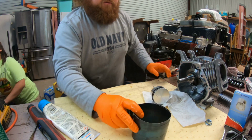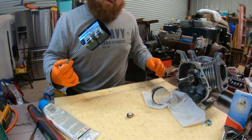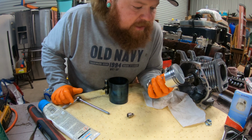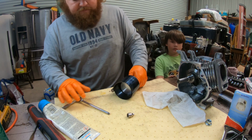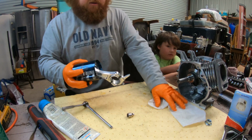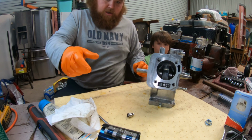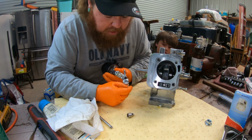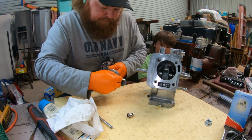Hopefully this compresses down enough. Alright. We'll start squishing this one in. Make sure one last time that you have all your rings where you want them. Slide that over. Tighten that sucker down. Now, take our case, take our bolts out. Since we oiled that bearing, make sure you don't lose a washer. We got oil in the case, so I'm gonna set these right inside the case.